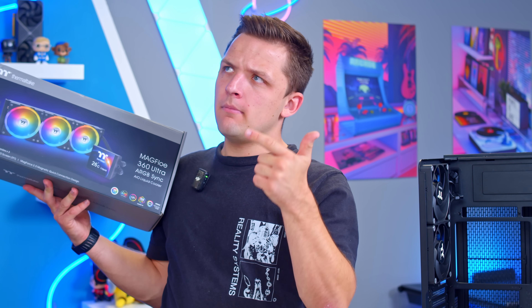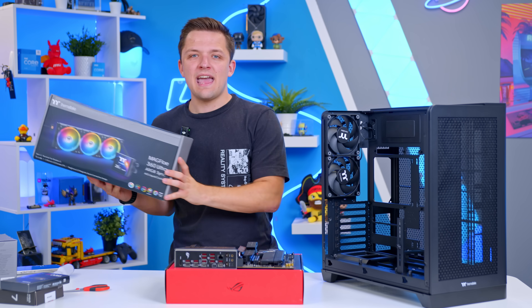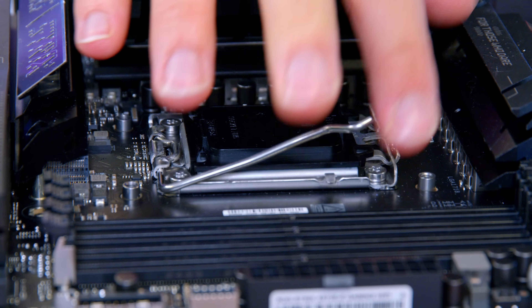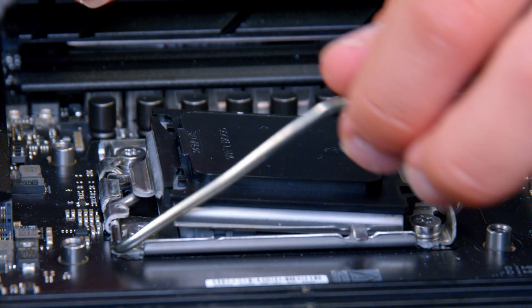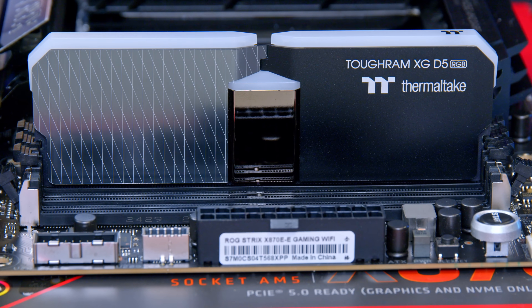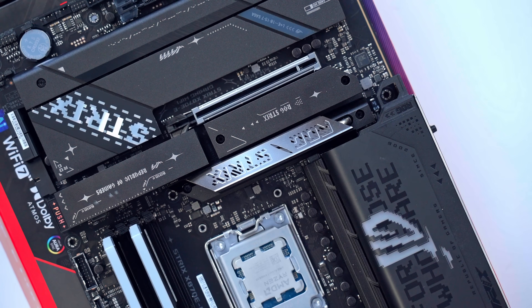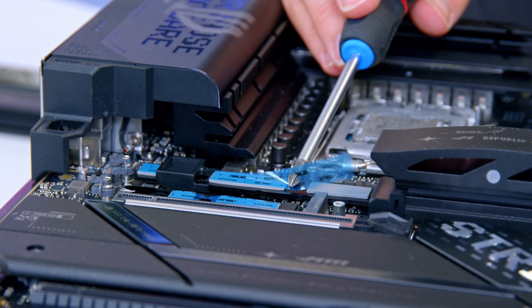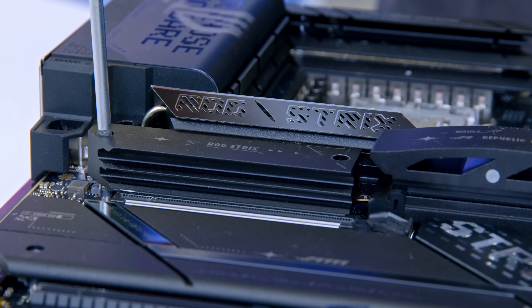As always, I'm going to kick off with CPU, RAM, and the SSD. CPU is going to be first — I'm just going to lift up the CPU socket, drop the processor into place gently, give it a bit of a wiggle, and then return the socket cover back down. Once that's done, I'm going to move on to the memory next. I'll be pulling back the clips on the second and fourth RAM slots for today's build and then sliding the TUF RAM into place — get that nice satisfying click sound and you know the memory is good to go. The SSD is next up, and to do this you do have to use a screwdriver to take out what looks like two heatsinks but they are actually combined into one unit. The retention method is nice and easily tool-less, but the need for a screwdriver to take the slot out is a little bit more hassle than you might imagine for a board of this price. The motherboard assembly is pretty much good to go.